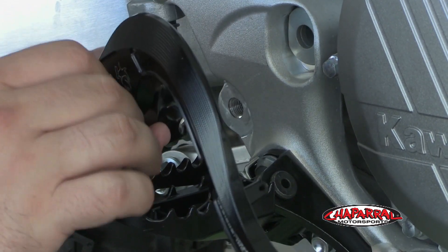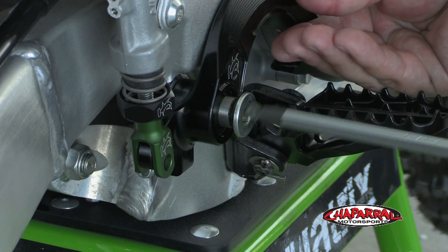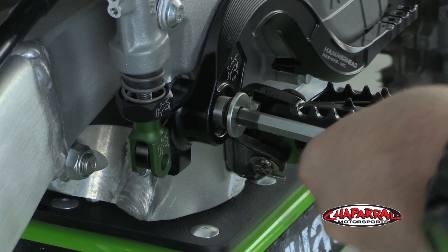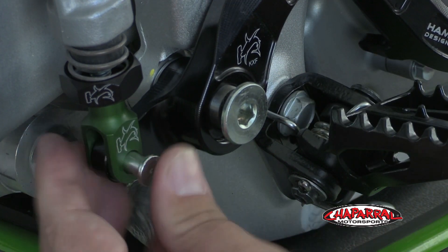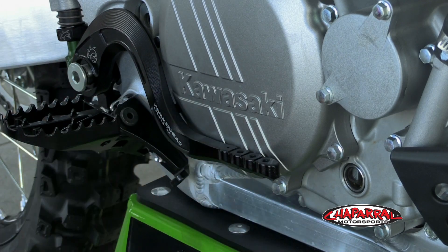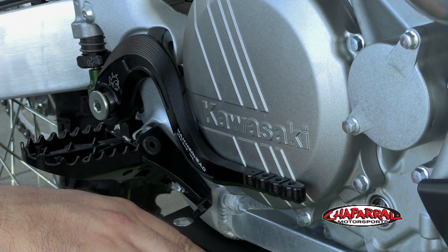You're going to use your stock brake bolt — if it's dirty make sure you clean it up and add some grease to it. Slide the lever through the clevis, making sure your washer is on the back side. Get it lined up with the hole and then you can start threading the bolt in. We don't want to tighten anything up too much right now because we want to put the pin in so that we can check the position of the lever against our mark on the case. As we can see, we're way above our mark, so we need to adjust the clevis up and it will pull the lever down.